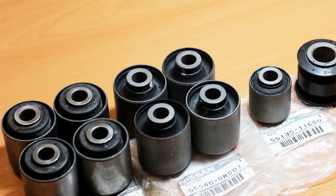Functions and purpose. First, you need to understand what silent blocks are and why they are needed in a car. Silent blocks, or rubber metal joints, are a special device of small dimensions which is responsible for reducing vibrations and noise transmitted from the suspension during its operation to the body. It is largely due to them that the driver and passengers feel comfortable in the car when driving on the roads. Structurally, the silent is made in the form of a pair of bushings made of metal, and between them is installed an insert of elastic material — often polyurethane or rubber, which are also often compared to determine the best solution.